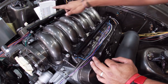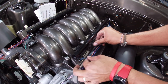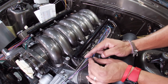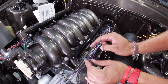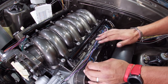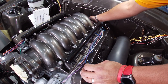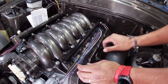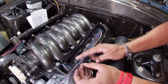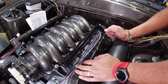I went through the wiring diagram and confirmed the coloured wires assigned to each injector are the right length. I'm going to run a switched 12-volt for the injector power since these are all ground-switching from the ECU and the other side must be the injector power feed. Rather than splicing them all at one point I'm going to tape and run the injector power with each individual wire and run it back down, which will make it easier to cut everything to the right length with less work on the bench.